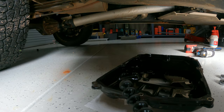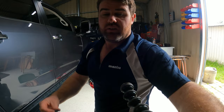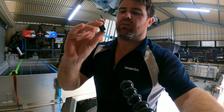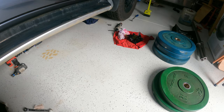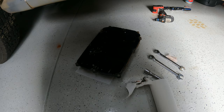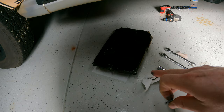In my Landy I only do the trans filter every second trans service and just do a fluid change every 30,000k's — which is a bit excessive but I do a lot of off-road driving and towing. The main advantage to doing your filter change is cleaning these magnets so they can pick up any debris and keep the oil nice. All I'm going to do is clean this trans pan up and put the old filter back in. I can't find a torque spec for these bolts but with a solid spacer you're looking at probably 10 newton meters maximum. Price-wise it's $270 from Isuzu for a genuine filter and $120 for the gasket, so Phil's just said to put the old one back in for now and we'll do it next service.